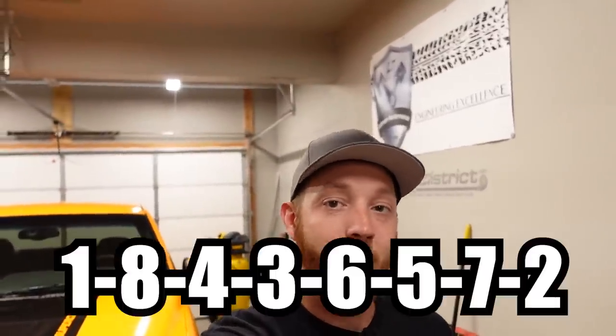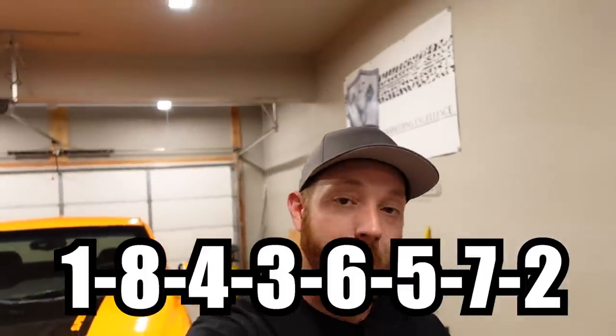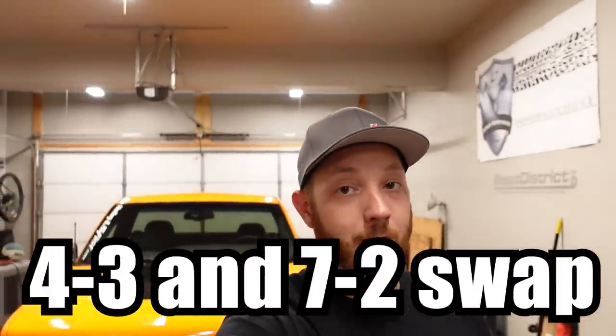an LS firing order. When we bought the cam, they just didn't have the right cores available and had no idea when they would even be back in. So we got a regular big block Chevy firing order. All we've got to do is swap around the wires for the injectors and for the coils on those few cylinders that are different. And if I ever decide to change it out, well, we just got to move those wires back. Not a big deal.